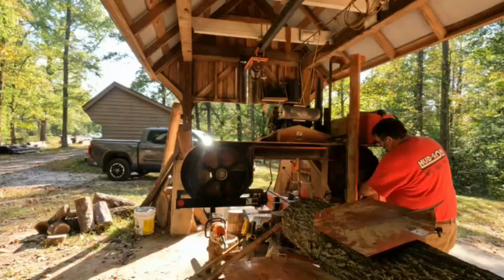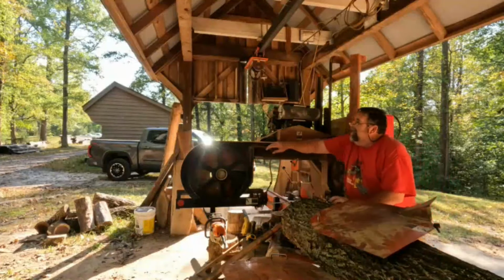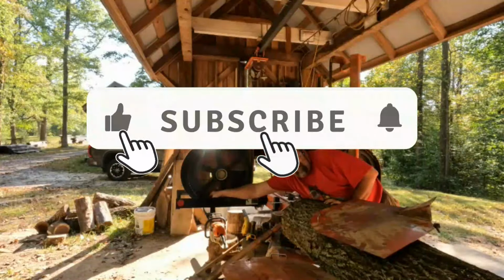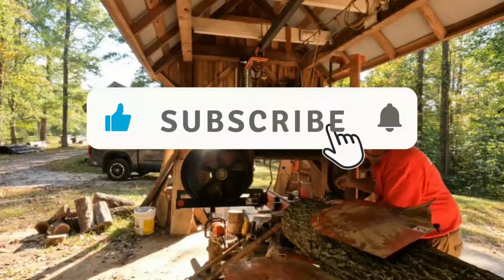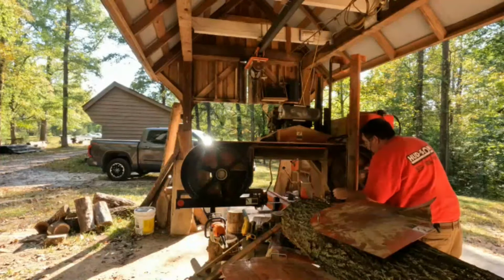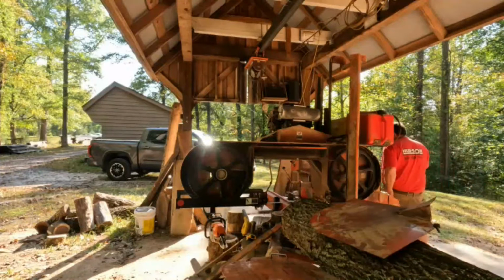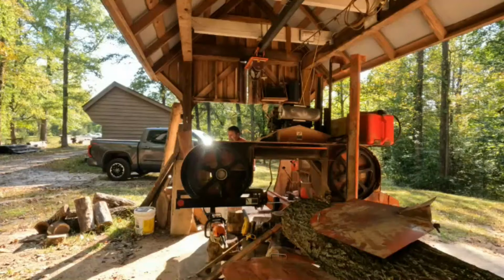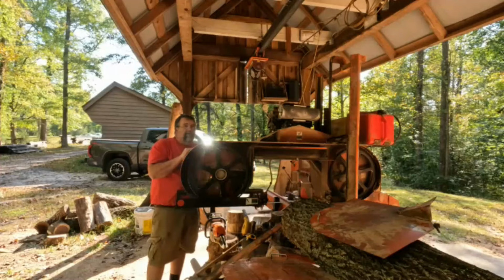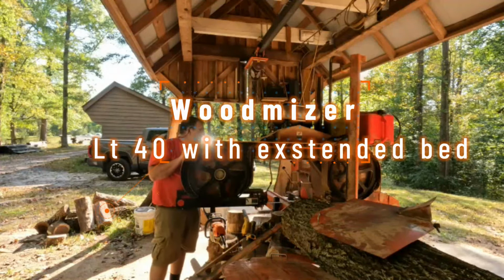Come over here and work the tire down. Get up and over. What happens when you push on here, it wants to push this out here. So that's what it just did. You just gotta reach across. Get it where it belongs. Top went over a little bit. That's why I always get it about where I want it. I tighten it up and then I test it. And we'll just snug it up, and then you run it for a little bit, and then you'll probably have to snug it up again.